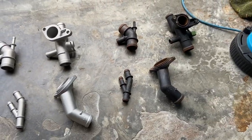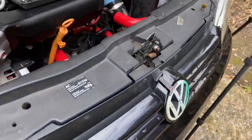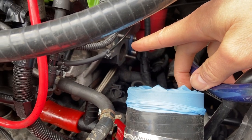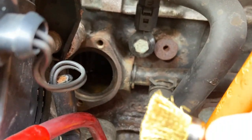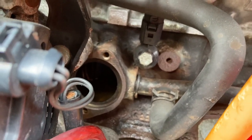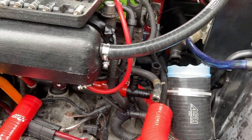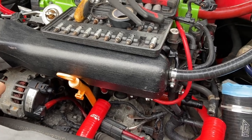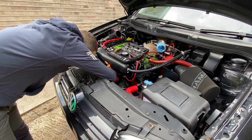All those are ready to rock and roll - that's just for a comparison. It's a new day today. Yesterday, which I didn't show on camera, I cleaned up that area because I had some old RTV on there - just used a blade to scrape that off. Then by the thermostat side I used a little brush to scrape in there and clean it up as best I could, ready for our thermostat and new seal. Now that that's done, it's just about fitting it all back together.